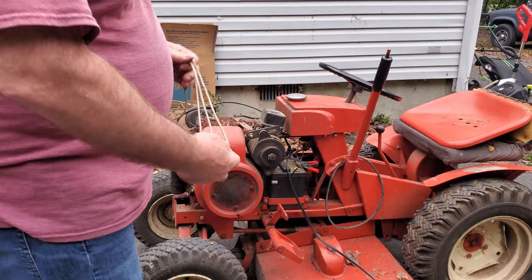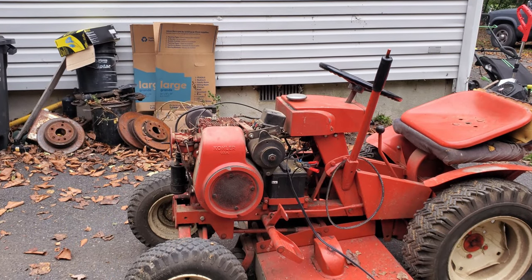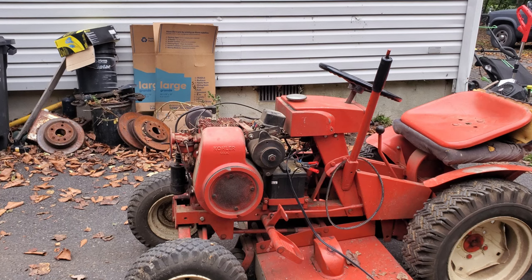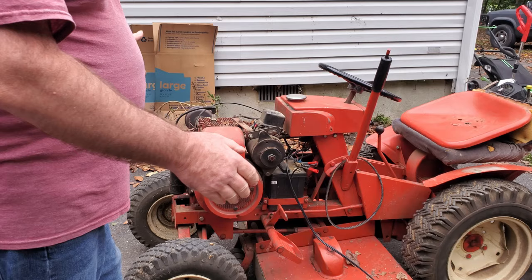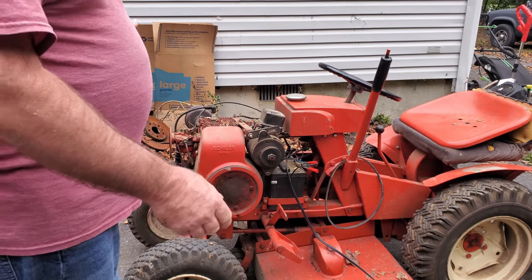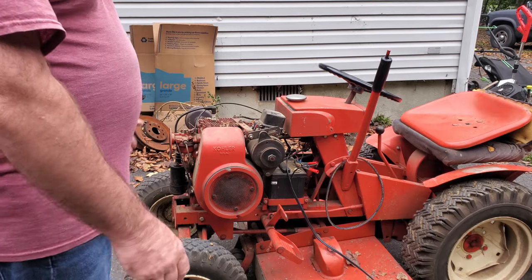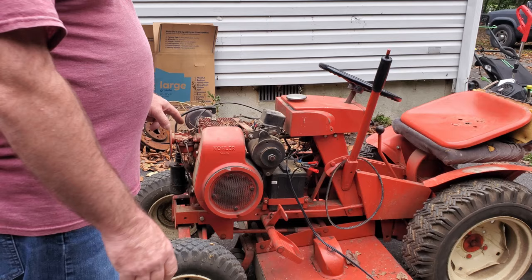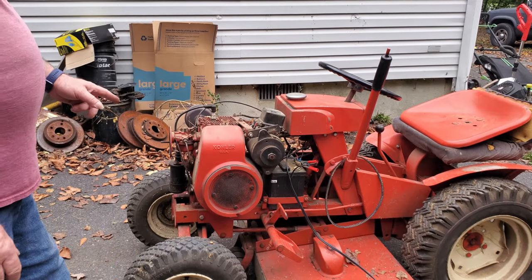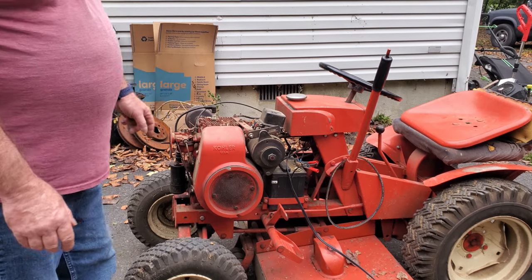She wants to run! So now we know it has spark because it fired up. We know it has compression, the valves are opening and closing. It started up and sounded good. There's something rattling in there — I'm sure everybody heard that — but I really think that's something that an outside visitor carried inside the engine.